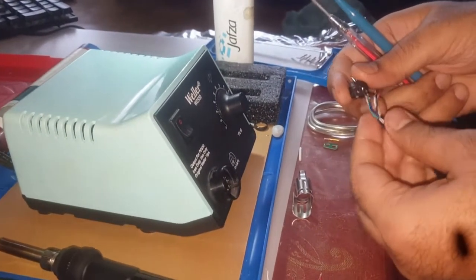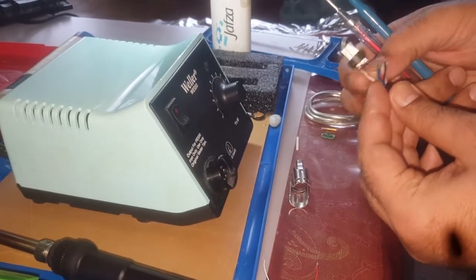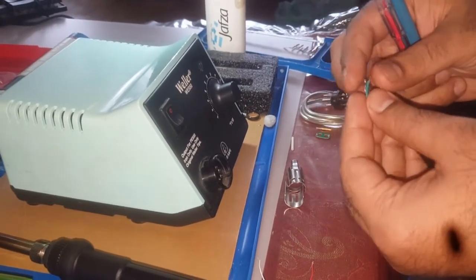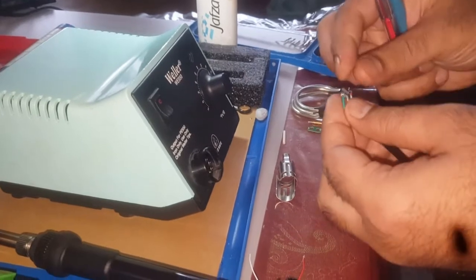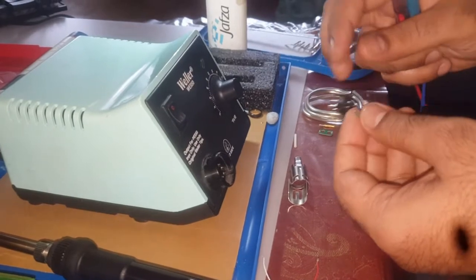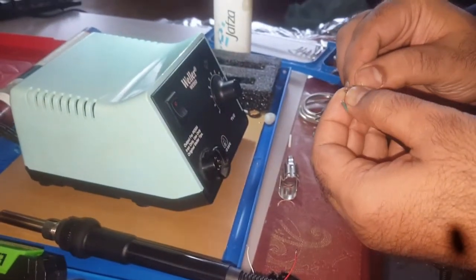You can see there are four wires plus one white wire — this is a ground, and the grounded one is on the fifth pin. So there are four left, meaning two are supposed to be for the heating element and two for the temperature sensor. I'm going to check it now with the digital meter.